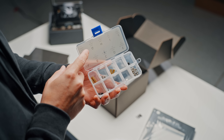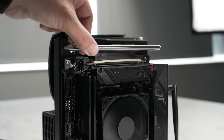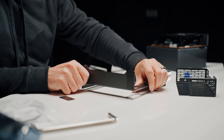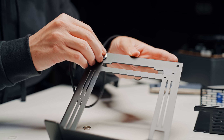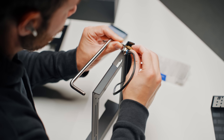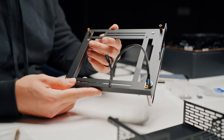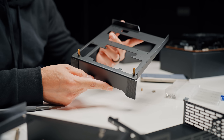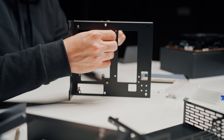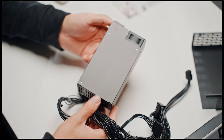All of these metal pieces are made of 1.8 millimeter black powder-coated steel, along with stainless steel accents like the handle and power button. Starting off the assembly, we just have a couple of rubber pads to stick to the bottom. Then we grab the stainless steel power button and secure it to the dedicated hole on the motherboard side panel, and attach the handle — the handle attaches with standoffs that also secure the second panel later. We then secure the motherboard standoffs. On the GPU side panel, we secure two standoffs for the riser cable, which we also screw in at this point.